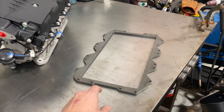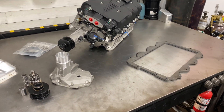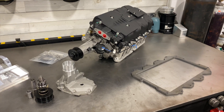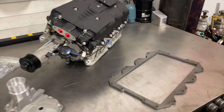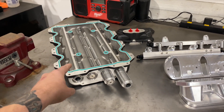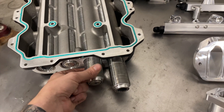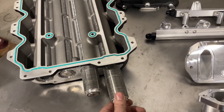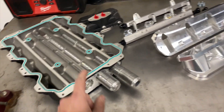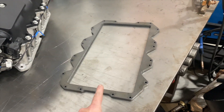What I really like is the simplicity of eliminating the heat exchanger, ice tank, all the coolant hoses, a water pump, and maintaining it — just a flat lid, no intercooler, a couple of meth nozzles, and a simple bolt-on kit with a progressive controller like what Alki Control offers. I personally think that would be a great option. We're going to have it on the website pretty soon — I just want to personally test it and make sure we can achieve adequate cooling without going to the giant air-to-water setup. I would argue that removing the intercooler, going to a non-intercooled lid, and running meth injection in conjunction with E85 would give you a really efficient setup.